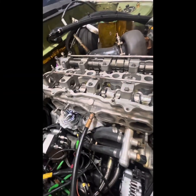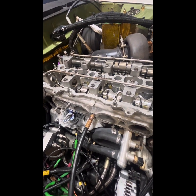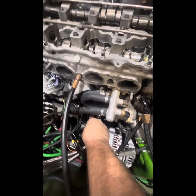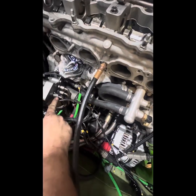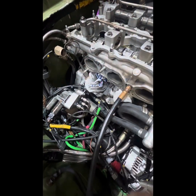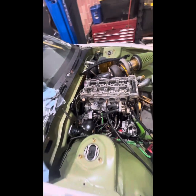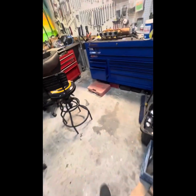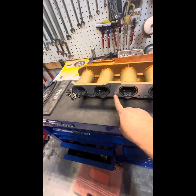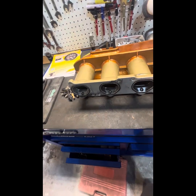This is how you can check to see if your head is getting oil pressure. Or if you're not getting oil pressure and you want to run an external line from down here, or from the oil filter housing, you want to run a pressure line right to this — it'll oil the head just fine. And you don't have to take the head off and redo the studs. The only issue with that for me is my intake manifold. You see that little circle right there? That's that plug. I'd have to machine out a circle, but there's not enough space for that.